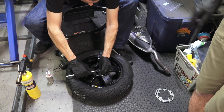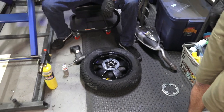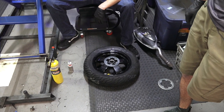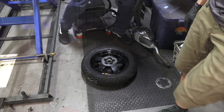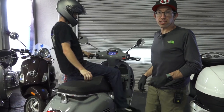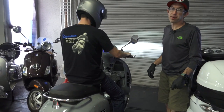The wheel goes back on. Now we'll jump into calibration of the traction control, because the only way this is going to work is if you recalibrate it. Whether you're just installing the speed sensor or doing a tire change, you need to recalibrate your ASR system.